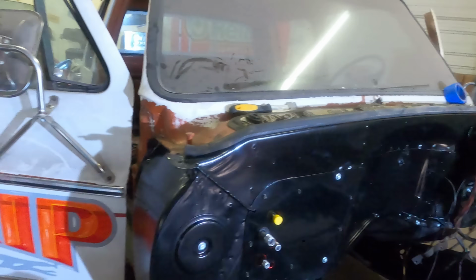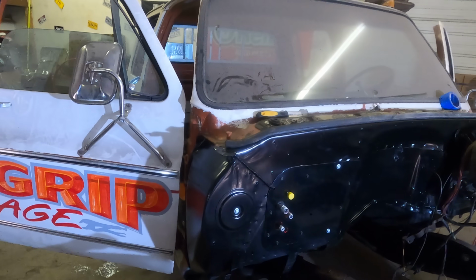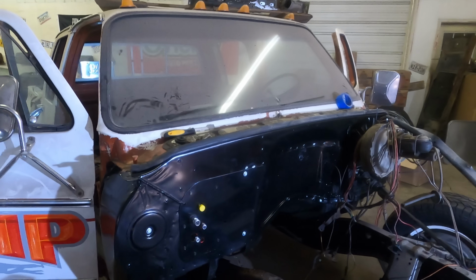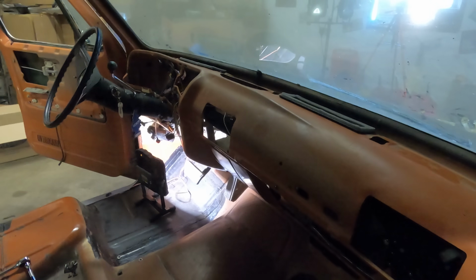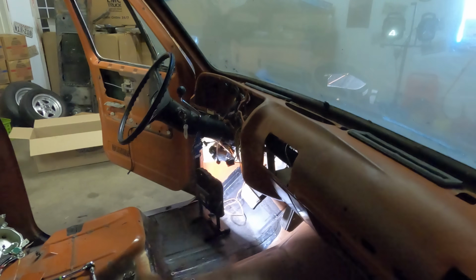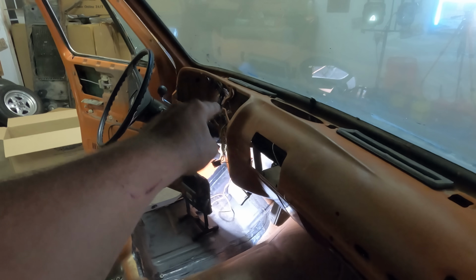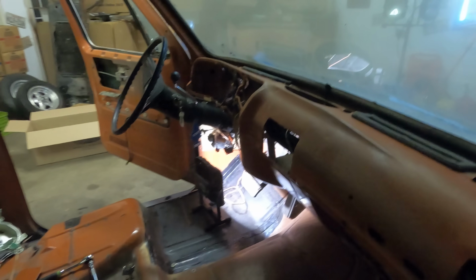Then I'd imagine at that point we're running the hoses to all the vents and stuff like that. And then my favorite part, digicals. Got the ducting in for the defrost vents. Here's a little trick for you here, fellers. This one I kind of struggled and put it on from the bottom there. And then my brain fired up for a second, and I just pulled the hose through the dash, popped that back out, connected it, then pushed it back down through, and that took 2 seconds.